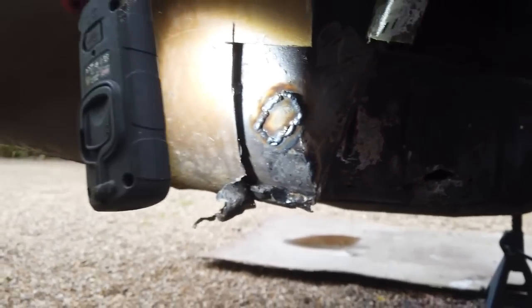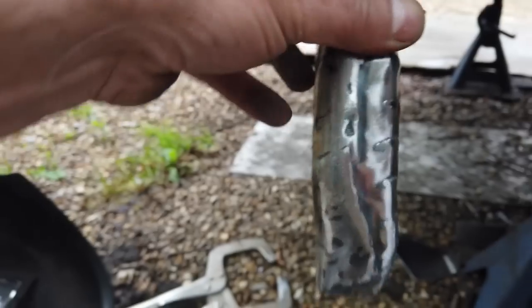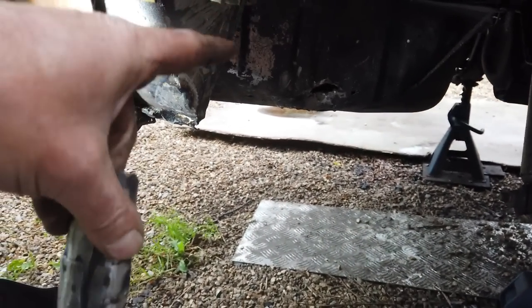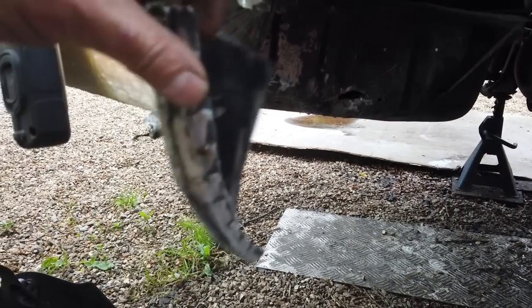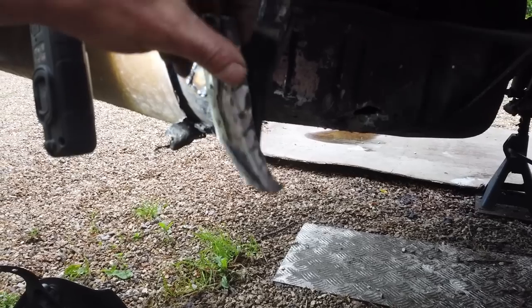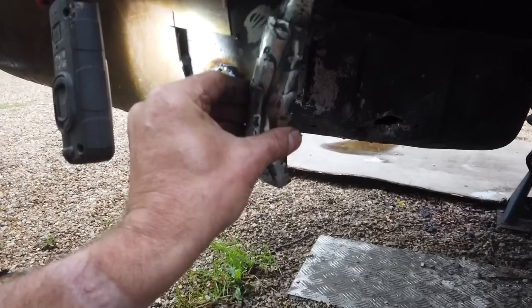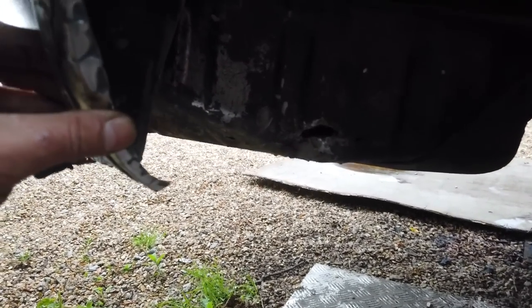I've got the plate off. You can have a closer look at the plate. See what we made. You can see how that's shaped as the lower piece of wheel tub. So it was a triangle, and then we cut serrations and folded it, but I shaped it before I removed the actual excess, the damaged metal. I bashed this into it to create the shape once I'd done the serration, so it kind of self-formed itself, and you can see how it fits. Look, in there it goes, quite nice.